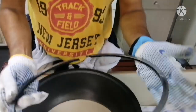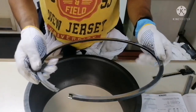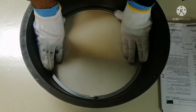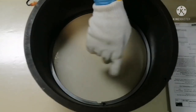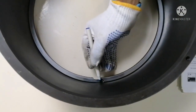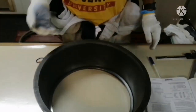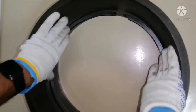This is our top ring. The top ring will always have this groove — this kind of groove will be there. When you want to take the reading, all you need to do is insert the piston ring inside the liner like this. This is how the ring should be placed inside the liner. For the top ring, the measurement should be taken between these two gaps.